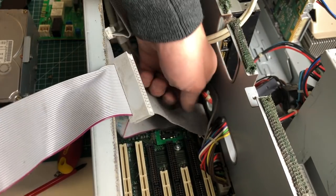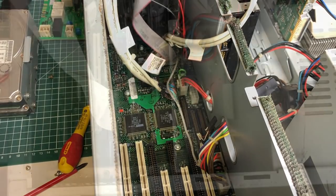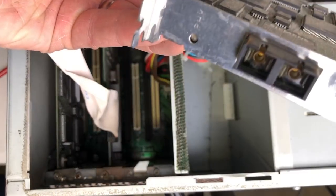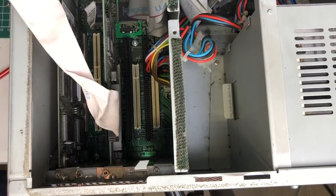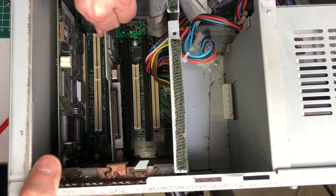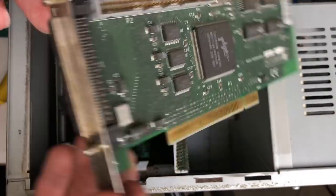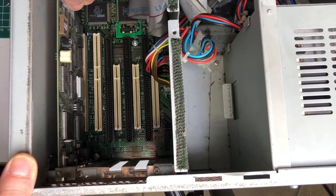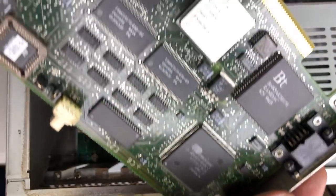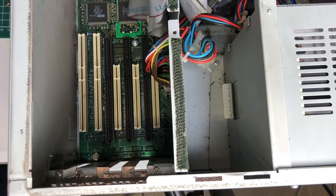The IDE cables hook up to the main board directly — we have IDE connectors on the main board, which is common for computers from this era. Let's also start by removing the expansion cards. Here we have some kind of networking card, an FDDI card that we'll look at later. We have the SCSI card here, which is a QLogic PCI SCSI expansion card — QLogic being a very popular brand alongside Adaptec for SCSI controllers. And here we have the video card, which is a Cirrus Logic video card with IBM-branded chips, and it seems you can also attach some 3D glasses.